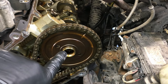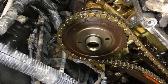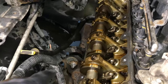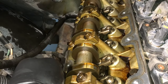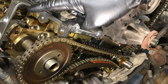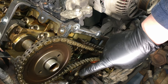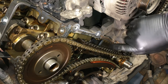It's close — we can just adjust it a little when aligning the chains during timing. This is probably how yours will look: crank at 12, passenger-side cam around 11. Now we can go ahead and lock down the cams. Install the holding tool in the second groove right here — undo the screws, clamp it around and clamp it tight while it's against the head on each side. That'll hold everything for us so it's safe to remove the rest of the timing components.